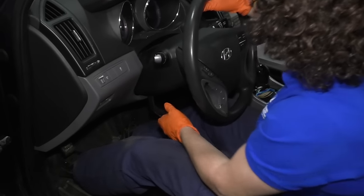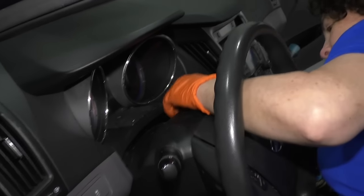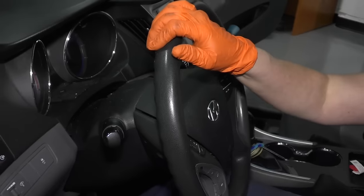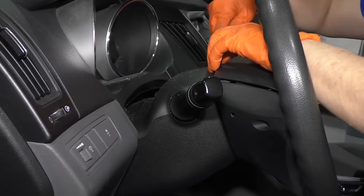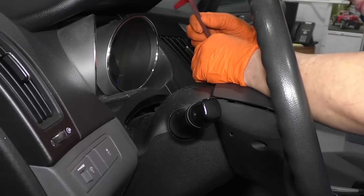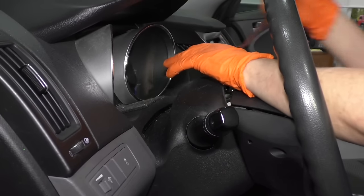You want to make sure that steering wheel is as centered as possible. It's a tilt steering wheel, so I'm going to loosen it up, and now I can grab this top steering column plastic cover and pop it up. You'll probably need a body trim tool to get in there and pop it up.